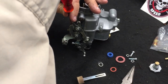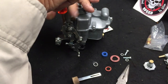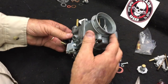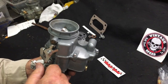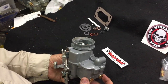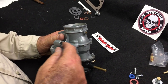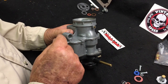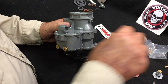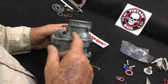Other than that, clean fuel, no more than 2.5 psi — I prefer to run 2 pounds. These carburetors have a real short float fulcrum like the Stromberg 97 and they're not designed to have a whole lot of pressure. You'll find that they run a lot better if you just run them on low pressure and clean fuel. Make sure on your fuel inlet that you use the proper fittings — if you're going to run hose, I have the proper flared tube fittings with the barb on them for installing hose. Don't use plumbing fittings; they'll screw in there, they're half-inch 20, but they're also the wrong thread.